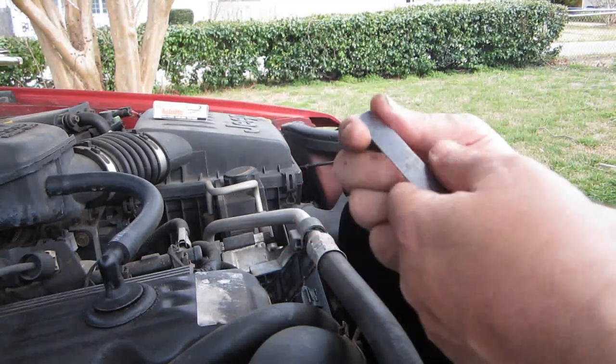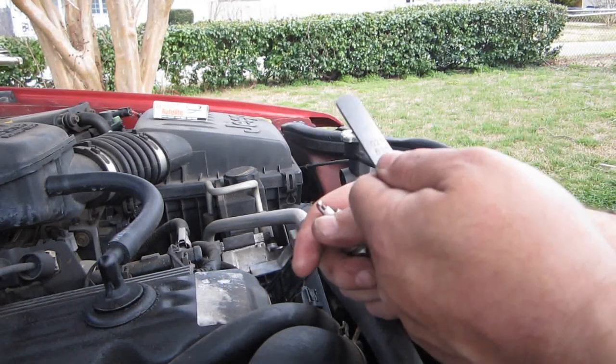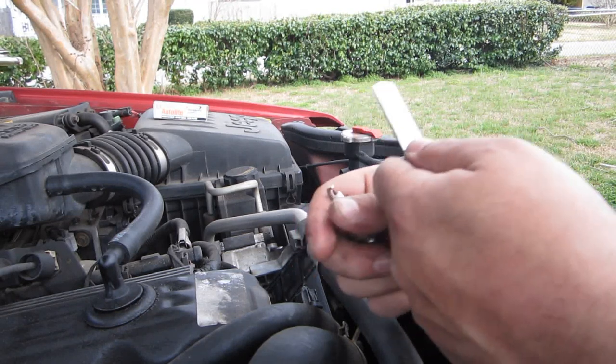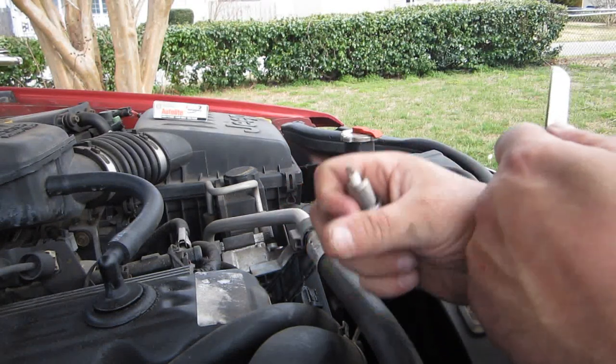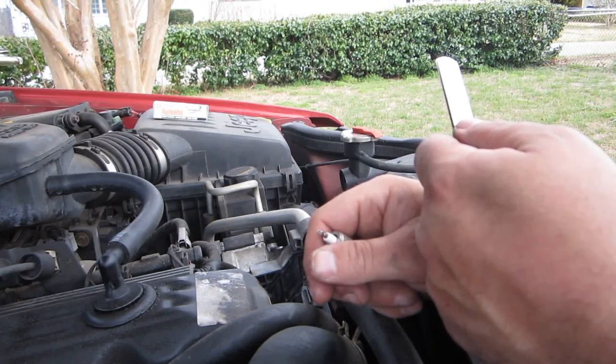I'm happy. There are other types of feeler gauges. They have wire feeler gauges where they have a little wire that's a certain depth. And those are very good, and that's what a lot of spark plug manufacturers recommend you use. They also have ones that you slide around a single disc and it gets thicker as it goes around. And those are good too if you know how to use them, and they're accurate.